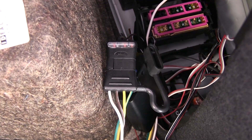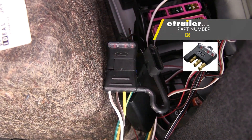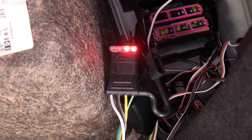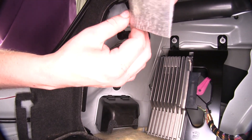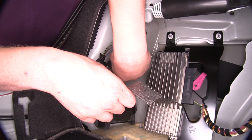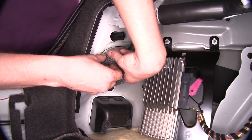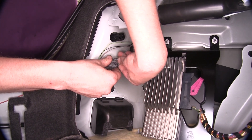Now we've gone through the learned procedure and we're hooked up to our trailer. Verify all your lights are working on your trailer. We've got our tester hooked up and you can see we've got our left turn signal, our right turn signal, our tail lamps, and our brake lamps. We'll now take the foam strips that come in our kit, peel back the adhesive backing, and place it around our wiring. I like to make sure the wire is kind of lined up in the grooves, put my foam on, and that just helps hold it straight. You just want to wrap it around your connectors to help protect and isolate it from the other wires. You'll do this with each one of your connectors.